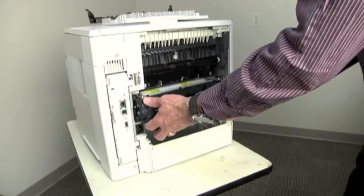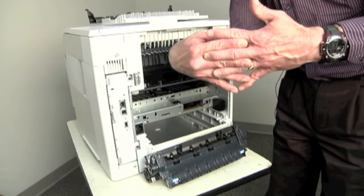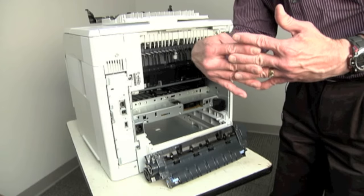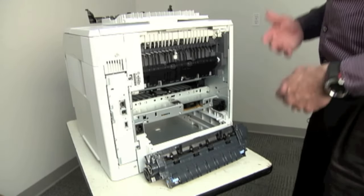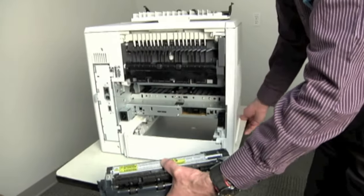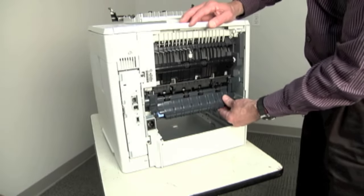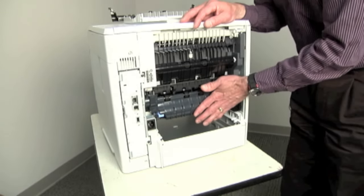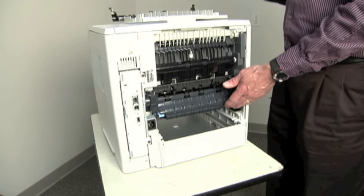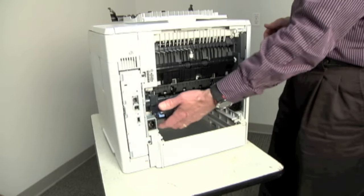Because what happens now? The gears on the fusing assembly need to mesh up with the gears on the inside. If those gears aren't meshing up right — we want a nice tight set of gears — but if it starts pulling away, we're working off the tips and they start grinding away at each other. They start chewing each other up. They may not grind right away, but they're going to grind in time and cause damage not only to your fusing gear but more importantly to the fusing drive assembly on the inside, which is not a whole lot of fun to remove from this machine. Best to avoid it. Put your fuser in, tug, yes, tug, yes — both sides. On the M606, 605, 604 series they really clip in well. On some predecessors — the P4015 series, 4200, 4250 — it wasn't uncommon to find that one of them did not get clipped in right.